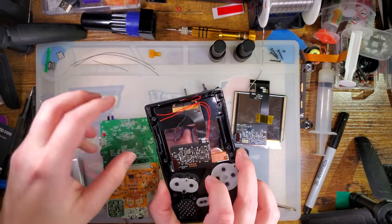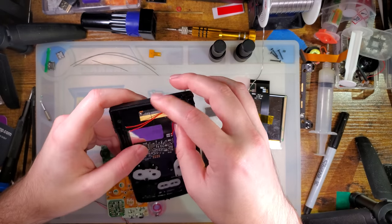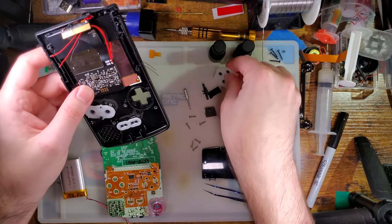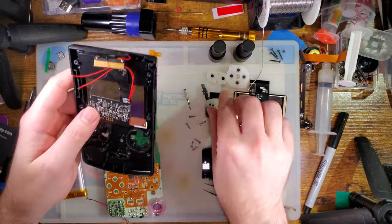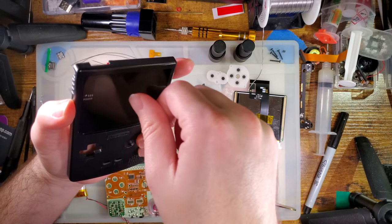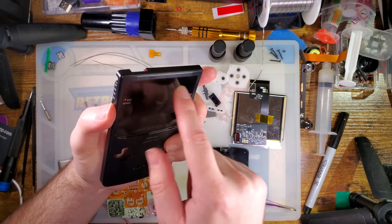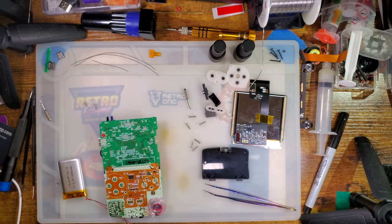This was the v2.2 ribbon — it's an older one. I'm not going to remove it from the shell; I'll just tuck this stuff in and leave it. If you did want to remove it, you'd take a little bit of hot air from the front to warm up the adhesive, then take a suction cup designed for disassembling phones, stick it up at the top, and it should come out. These screens are relatively inexpensive as long as you don't ruin the ribbon.